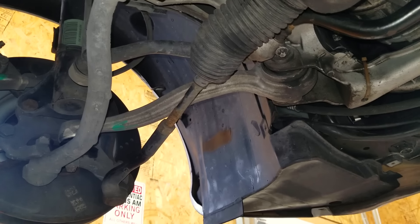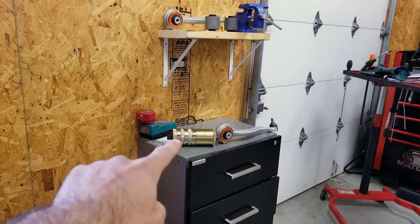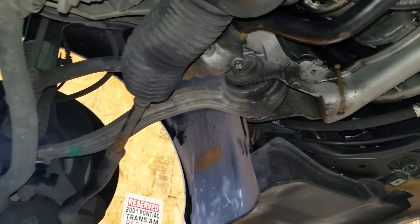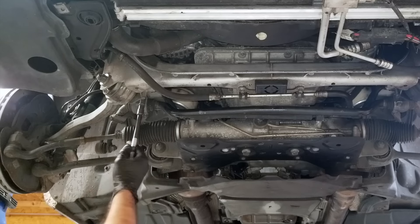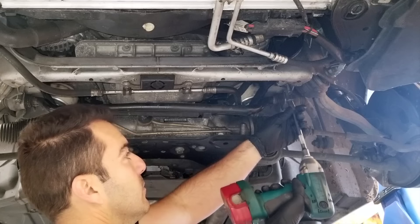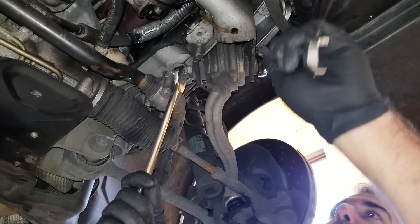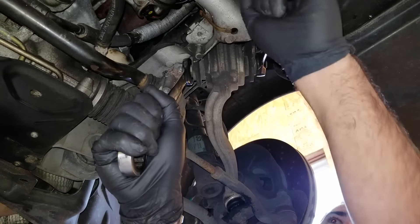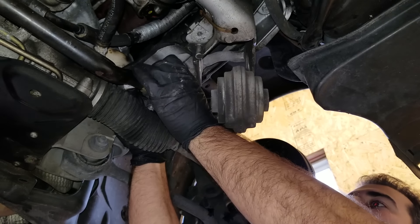Method number one is by far the easiest and the cheapest method of the bunch, but it does require the use of that special tool right there, which I'll show you guys in a minute. First, what we need to do is lower this part of the control arm down. You need to remove the four bolts that hold the sway bar onto the subframe. Start off by hand with a ratchet to break the bolts loose, and then you can use your impact to speed things along. Now, take two 21-millimeter wrenches, preferably ratcheting wrenches, and start to turn the large bolt and nut that goes through the thrust arm bushing. Once you remove the nut at one end, just push the bolt through and you can lower the front of the arm.